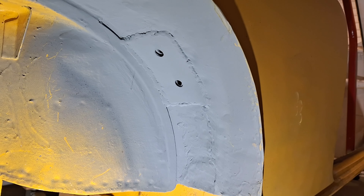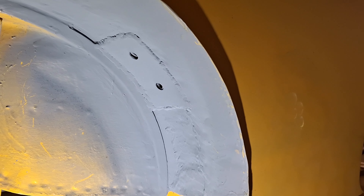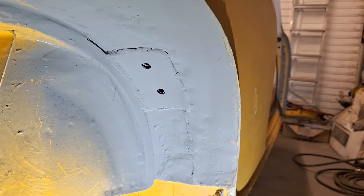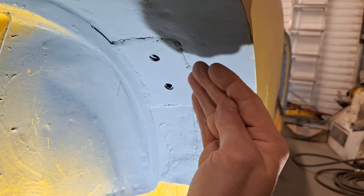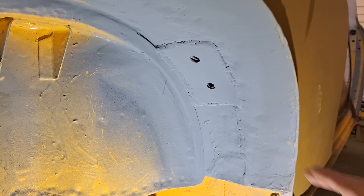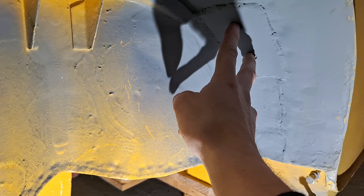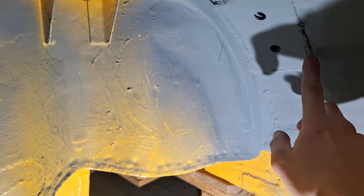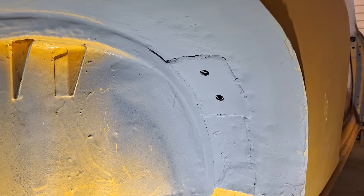So this is it — a three mil steel plate welded all the way around. It's a bit difficult to bend that steel because it curves around and is slightly curved inwards as well, which makes it a real fiddle. Get the curve bent nice, then get it to fit roughly where you want it, put the two mounting bolts in with massive washers, crank it up really nice and tight and it will form to most of that shape. I also used a heat gun — if you've got oxy-acet, even better — get it nice and hot and really shrink that in.